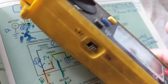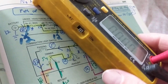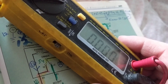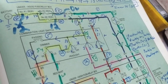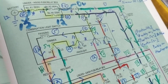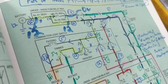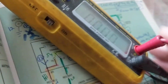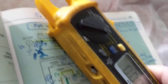I've been asked who makes this meter — it's more than 20 years old and I can't even find the manufacturer. There are so many good ones out there today and they're much cheaper. Try to get the highest amp rating you can — you might draw 600 to 700 peak amps when you first start the car because you're shocking the battery until it settles. So 400 to 500 peak amps on a clamp meter is ideal, though at those ranges it might only be a current meter without volt or ohm features.